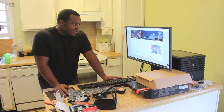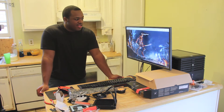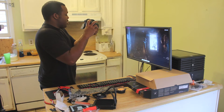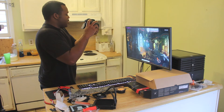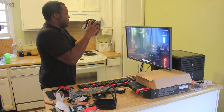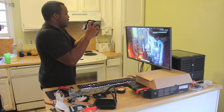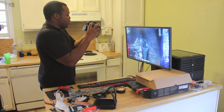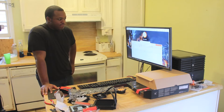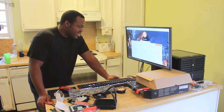Going to not include the demo — we'll be here forever. Now going on Fire Strike, seeing if that's able to push the card any further. We're on the second stage of the Fire Strike test here, running a good 40 FPS, still 48 Celsius, 100% load, 1050 MHz, 500 MHz on the memory clock. CPU running at about 46 Celsius. During the last Time Spy test I kind of saw it kick up towards the high 60s. We're running a boost up to 4.2 GHz — I'm not doing anything too crazy with the CPU, which unfortunately is going to hold the benchmark a little bit back. But I'm going to maintain that for both tests, so I'm not going to run one test overclocked and the other not. Alright, we got a total Fire Strike score of 12,704 and a graphics score of 16,321.